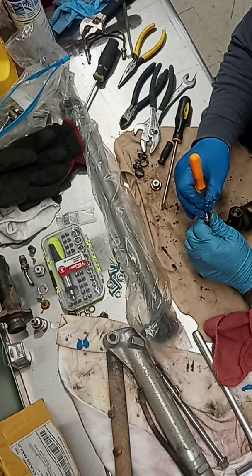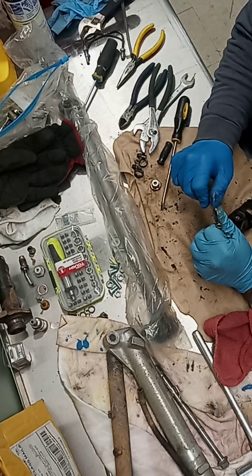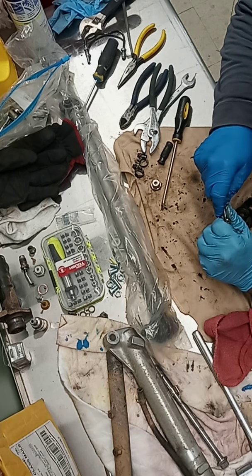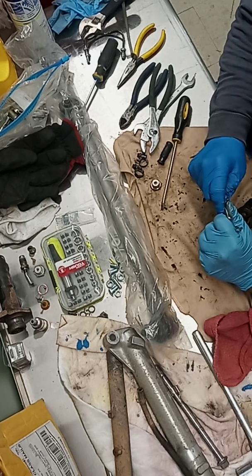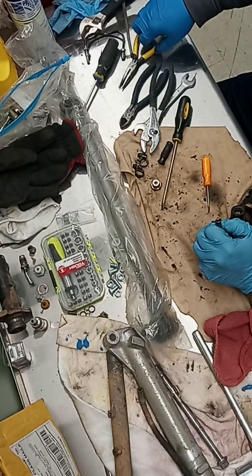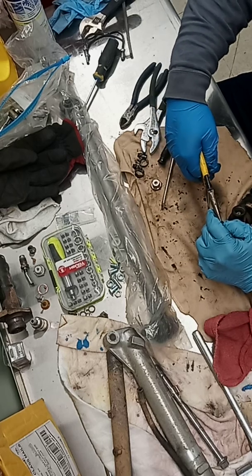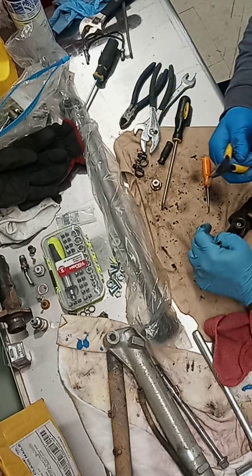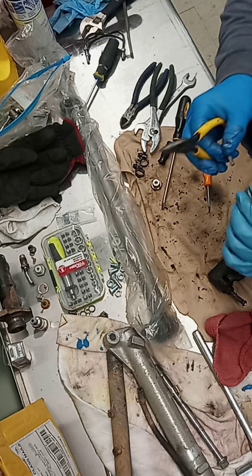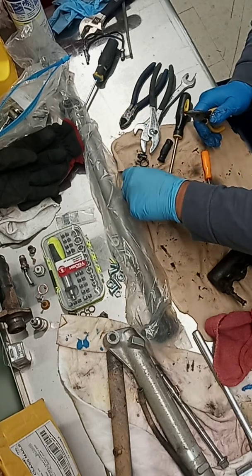It sits right inside this line here. You want to be careful with it — it's just a piece of plastic, kind of like the screen assembly that sits inside your petcock on a motorcycle or ATV. There you have it, just a little bit of screen and it does have some debris in it. We're going to put all this into the solvent tank and clean everything up real good when we're done.